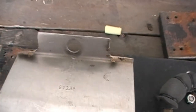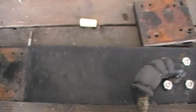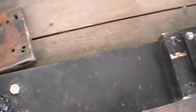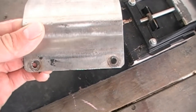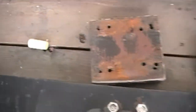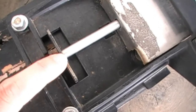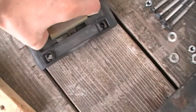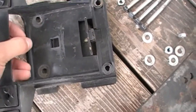Here's the other one — these are the original metal plates from the police car light brackets. They have screw holes here, and those are for screws that actually screw into the roof of the car. Then they attach with a big 3/8 bolt that goes through the hole in the middle and threads back into a little plate on the other side, which sits down there and you thread the bolts in and screw it down tight — that locks the rack down.